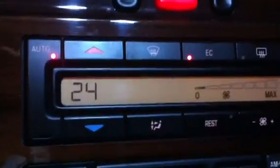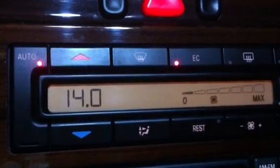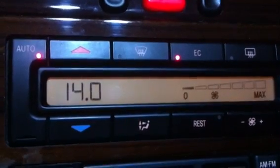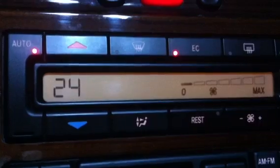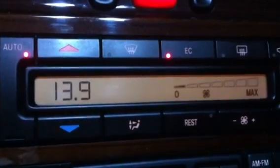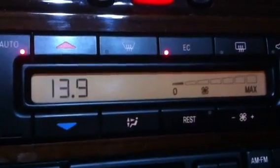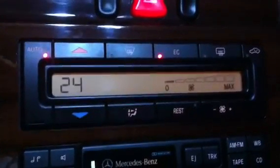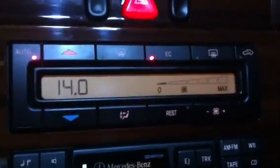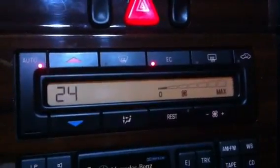It's actually better to check the battery voltage after you haven't driven for a while and the car's been sitting. For alternator voltage, anything between 13.1–13.2 and 14–14.1 while the car is running is absolutely fine. If you've got everything turned on it might be a tiny bit lower, but you don't want to see it down in the 12s unless you've got a big amp draw. Anyway, that's about it — hope that helps somebody. Very easy way to check your battery and your alternator.